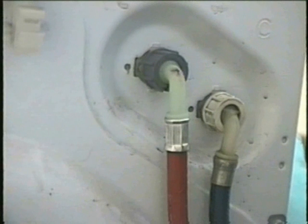The other obvious reason for no water is if the tap has been turned off or if there is a restriction at the tap end. To check this, turn the tap off and remove the hose from the valve. Hold the end of it over a bowl or bucket and turn the tap on again — this will tell you if it is the tap or the valve. Remember when fitting these hoses to include the rubber washer and don't over-tighten the nut because you could strip the thread. They only need to be just over hand tight.